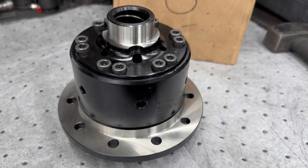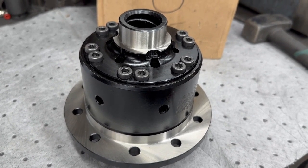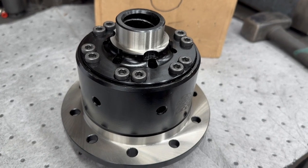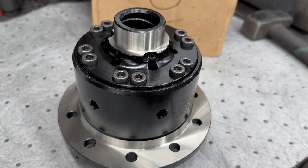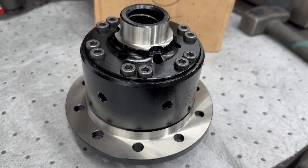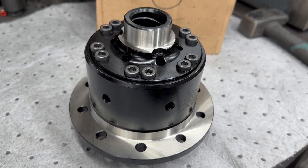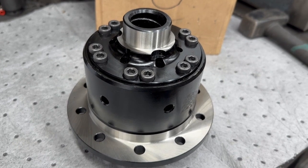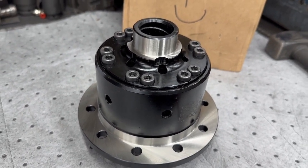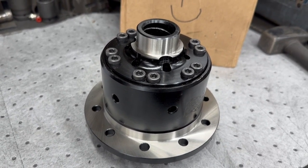This is a very special ATB — I'm going to give you a lot of information in a very short space of time. ATB: automatic torque biasing differential, or in old money, LSD: limited slip differential. The difference is that an ATB works by using gears — this one has eight gears inside, six small ones and two drive gears. An LSD works with plates. In simple terms, plated LSDs are more suited to racing environments; ATBs can be used for racing but are also very road-friendly because they don't wear like a plated LSD. However, a downside of an ATB is it's packed solid — there's no space inside, so if you chip a gear or break a shaft you'll very likely blow it to bits.